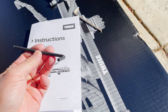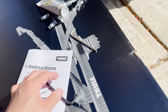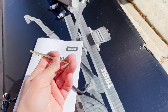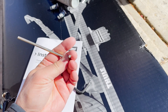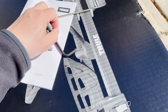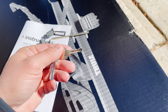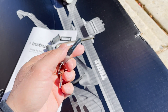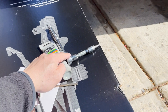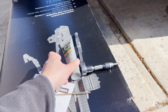The main support bar bolts are five millimeters, and the end cap finishing screws are a smaller size — probably a three or four millimeter. The rack comes with three lock cylinders and three keys, plus a master blank key used to remove the cylinders. I also like to use a five-millimeter hex socket as well as some silicone lube, which I'll explain later.